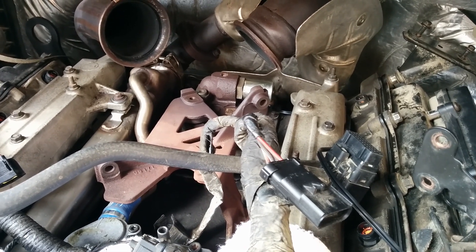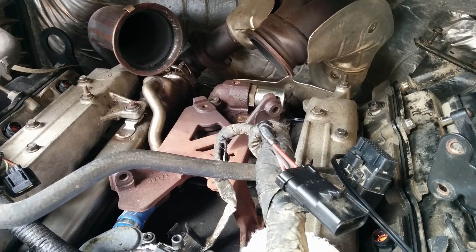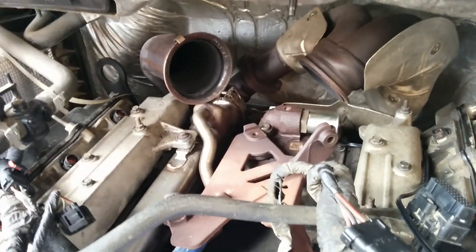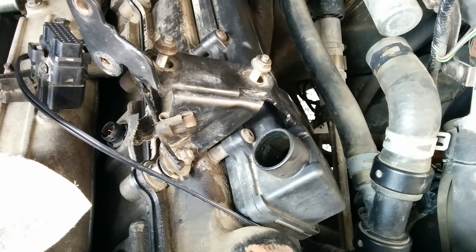If it's dumping air through the IPR, it's a pretty close exit there to the drain tube fitting. It's not venting really noisily through the oil filler cap or through the crankcase ventilator on the driver's side.